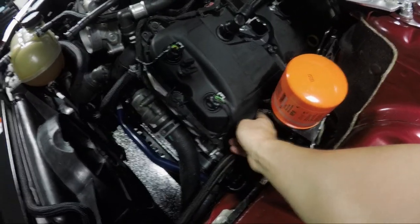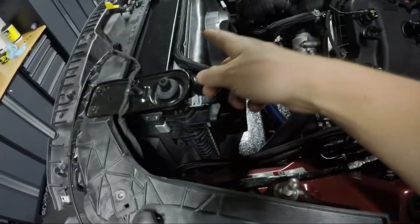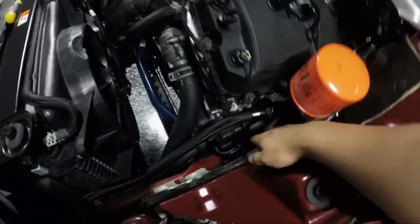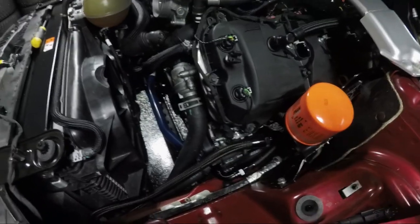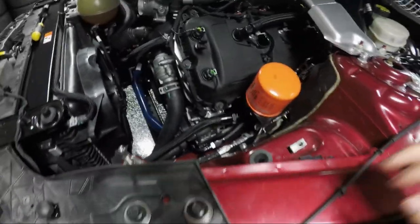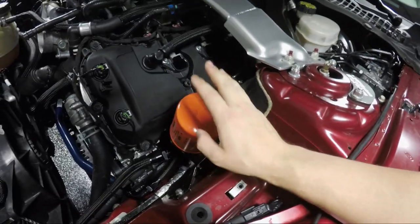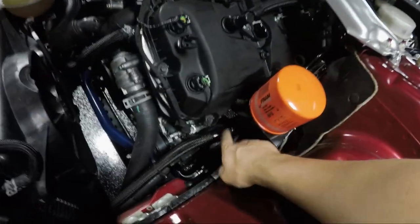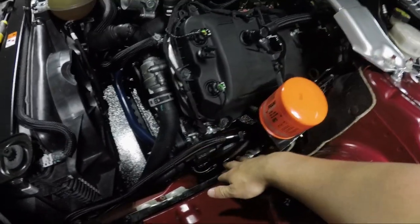Let's take a look at the oiling situation. I have a distribution block attached to the engine block down here. It feeds an outlet that goes into this remote oil filter, which sends oil to the oil cooler, which sends it back into the block. There's also my accumulator in the trunk that supplies oil for pre-oiling during startup and injects oil back into the system in case of low oil pressure. The reason I don't like the current setup is that the remote oil filter pushes down on the distribution block, putting additional stress on parts, and I'm not a huge fan of that.